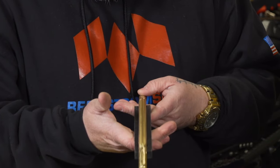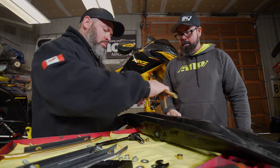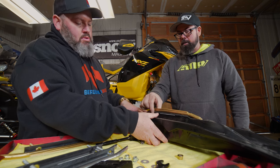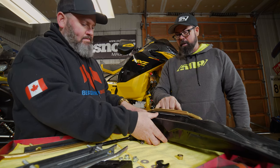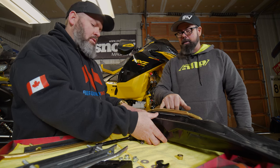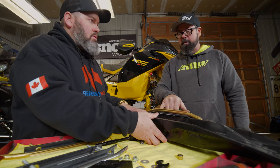That is our eight-inch triple point, and we have our ski saver that we're going to put in there. You can really see how that gives a little bit taller carbide profile. That is going to wear away, which you expect, but I'd rather have that little chunk of UHMW plastic going away than a $600 ski.